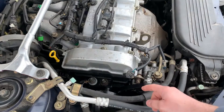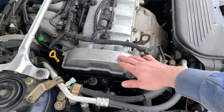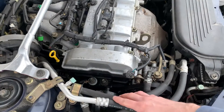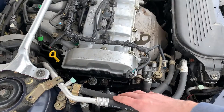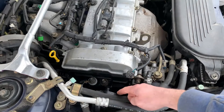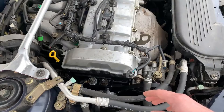You'll need to remove the belts, the timing covers, and the valve cover as well to get the first timing cover off, and you'll have to unplug some electrical around this area. You don't need to remove the AC lines. You'll remove the engine mount, the main pulley, and the harmonic balancer. The timing gear behind it will also have to come off, but that one's kind of tricky.